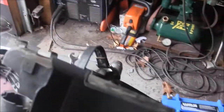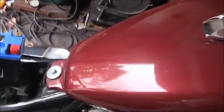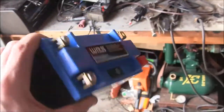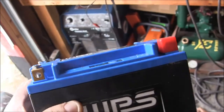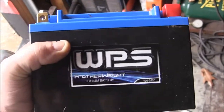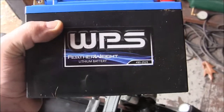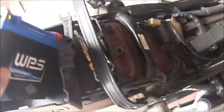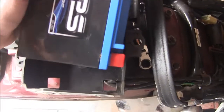This is the battery box — it normally sits right in here. The problem is I went out and got a better battery for this bike. It's a lithium-ion polymer, it weighs about three pounds and has 420 cold cranking amps. My old battery weighed about 16 pounds and had 190 cold cranking amps, and it died all the time. So we got a better battery. The problem is the battery will fit in the battery box thickness-wise, but...